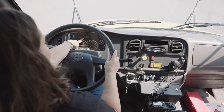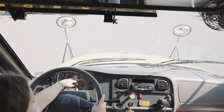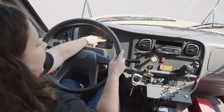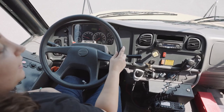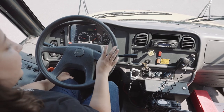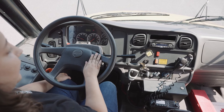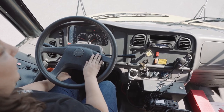My mileage and my volts are clear and visible if I need them. And my primary and secondary air tanks needle is building back up air as I need it. And then I will wait until the air pressure's raised up to 120 PSI to 125 PSI, where the air will then cut off for my air brakes test.